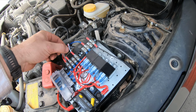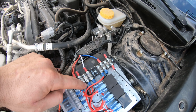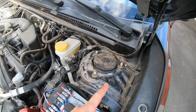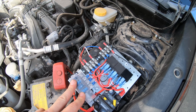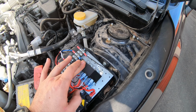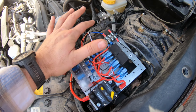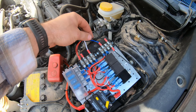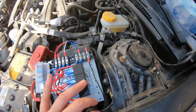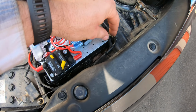So all the black wires that you see are actually grounds that are heading to the switches, which when the switches are closed create a pathway for electricity to flow and close these relays, which sends power out of my red lines to my accessory. And since I've only got one thing hooked up for now, I've got this pretty low gauge wire just headed back to the battery tap.